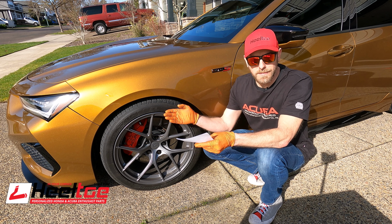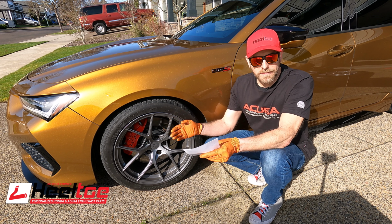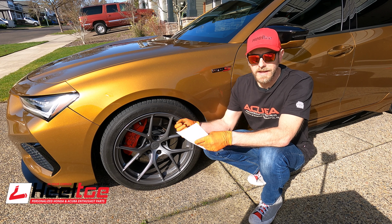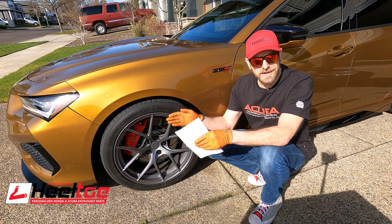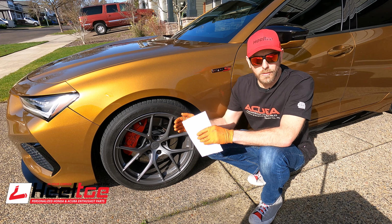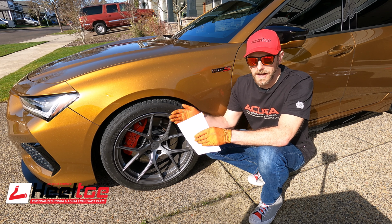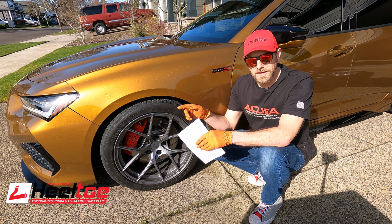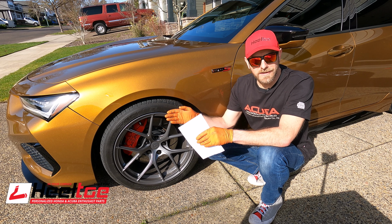Now, of course, they don't make spacers in that size. They make a 25mm from Fastline for this car and a 27mm from H&R. So to get a factory wheel in about this spot, you're going to be somewhere in between, right? A lot of people favor the 25mm just because it's on the slightly more conservative side of that total offset change. So watch this clip and we'll show you the detail of how this wheel fits against the fender.